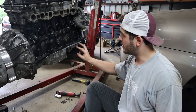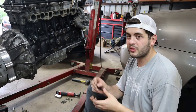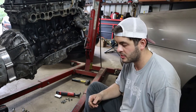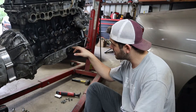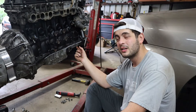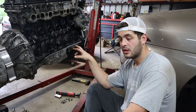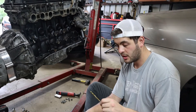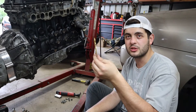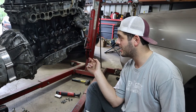The first thing we're going to do is go ahead and drill what we need out of our oil pan, which is kind of nerve-wracking. The holes start at roughly 3/16ths. I went up to a 7/32nd which actually started removing a little bit of material. The holes are about 20mm deep already and they're perfect. You do not want to drill all the way through the pan. For an M8 by 1.25 thread you want a drill bit that's 6.8mm, which equates to 0.26 inches — almost exactly a quarter inch — so we're just going to use a quarter-inch drill bit.